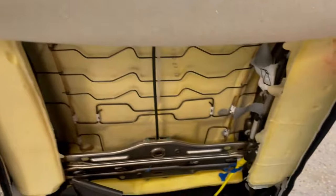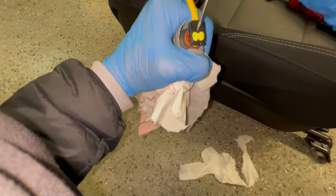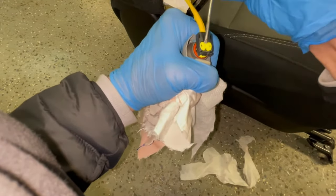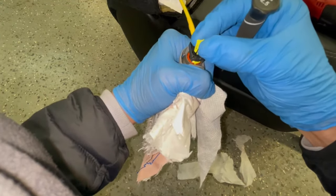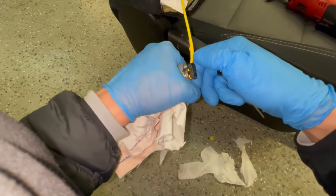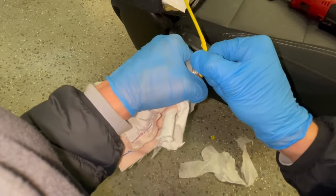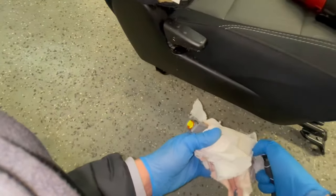You don't have to take the back off — I did it just because I had to. Once you have the airbag out, I get the small screwdriver and I pry this up. Be really careful not to break this yellow tab. Pull slowly, and then you're able to just pull this out — easy as that. And then this is garbage.